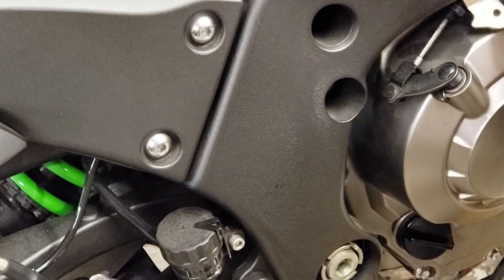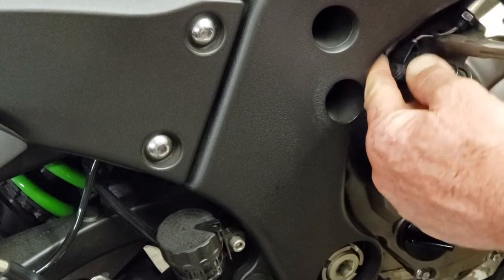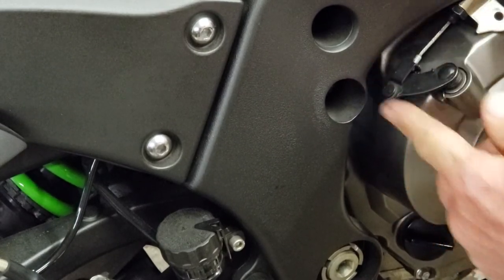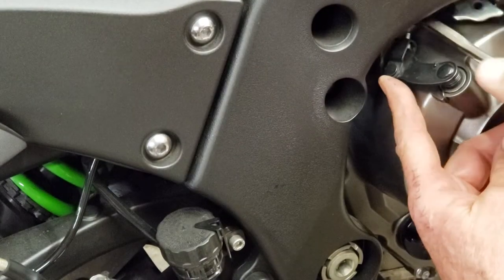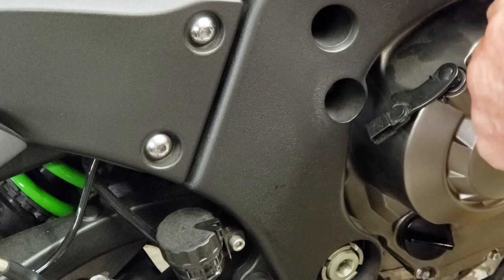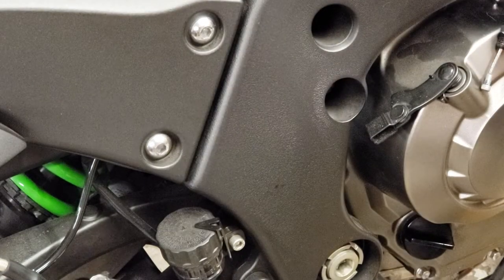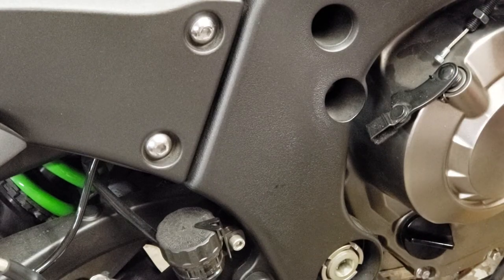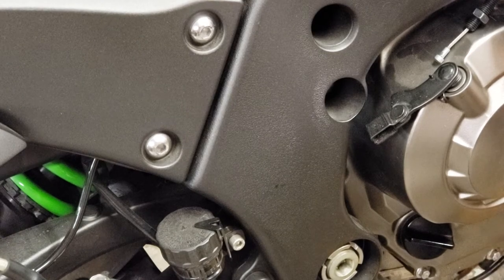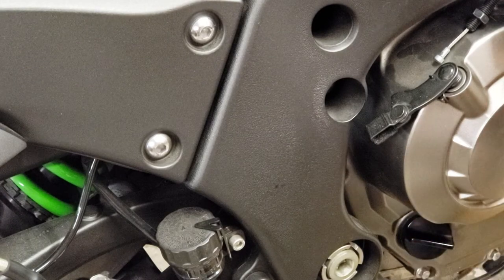I got this loosened up and unbolted. Now I want to push this cable back through and get that thing through there, take the clutch cable out. There we go. Be careful about your clutch arm - it's kind of funny when you go to hook it back up. I'm gonna go ahead and take all these little fasteners off right around there. The oil is below so I left it leaning so the oil won't run out. I'm not gonna change the oil tonight and I'm not gonna put the fairing back on tonight - I'm gonna get the clutch in and get her sealed back up.